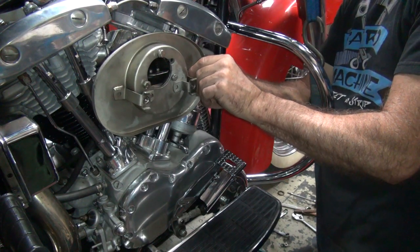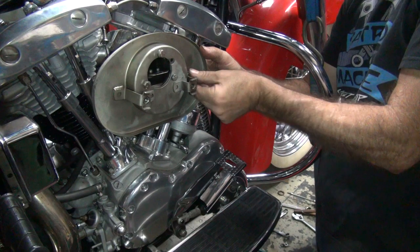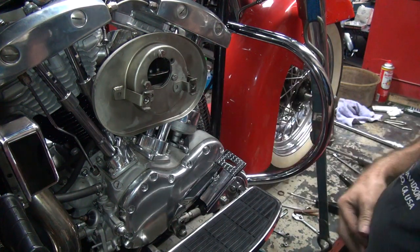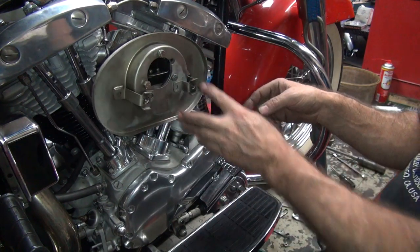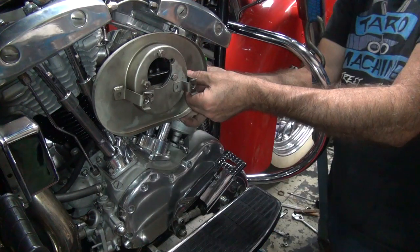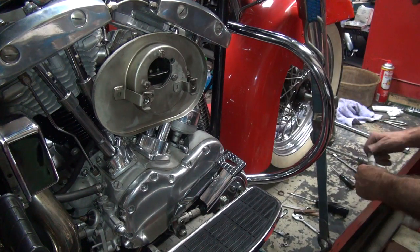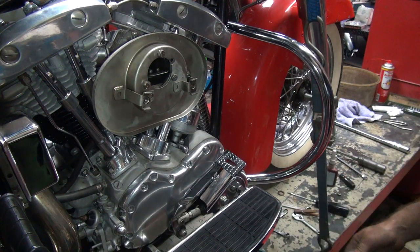This up over here. Now, I don't want the nut on the inside of the air cleaner because two reasons. Sometimes a filter hits against that and the nut's taller. The other thing is when that bolt falls out, it's so big it usually drops down here. Rarely will it ever go in that hole. That nut probably won't go in there either, but it might. It's a lot smaller, it can bounce up in there. I'd rather have a bolt bounce in here than an open nut. So you always got to look at what happens if something goes wrong. There's always a fail safe in there someplace.